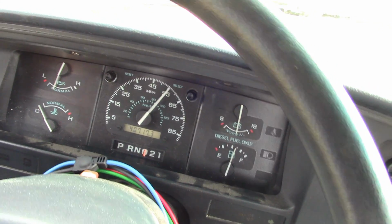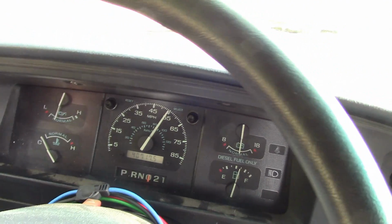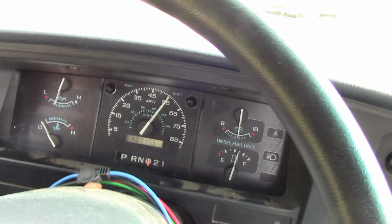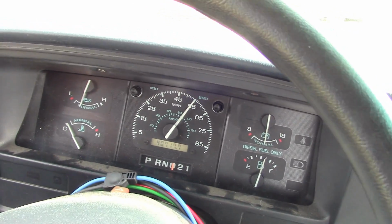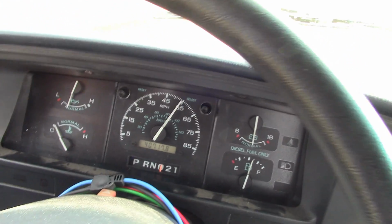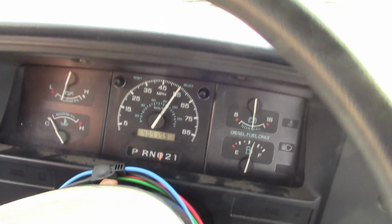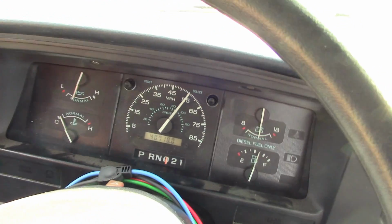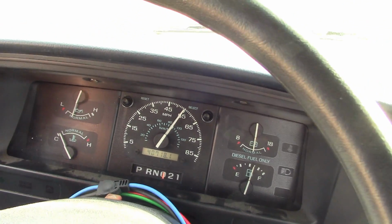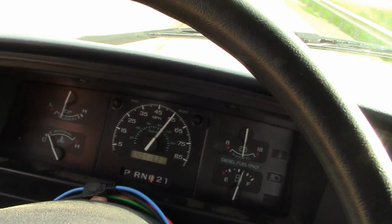Finally! Oh, that's awesome. Yeah, there's too much glare to see the pico scope, but I can tell you that it looks pretty good. Oh, fantastic. Man, I was really nervous. We've tried so many things and found so many problems. Who would have thought that a tone ring inside of an axle surrounded by oil would have been rusted, corroded, and caused this problem? I certainly did not. Yeah, it's rock steady. Alright, let's see if the cruise will work. Oh yeah. Fantastic.